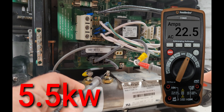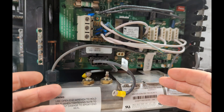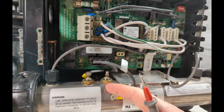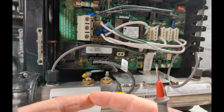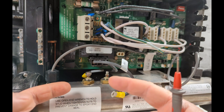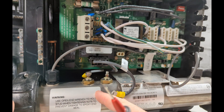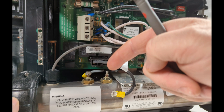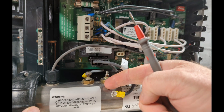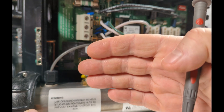The reason I show you four different ways to test — ohms, volts, continuity, and amps — is because each one has limitations. Sometimes you'll get continuity even with a pinhole in the element, or you'll get volts on the element but then zero amps. That's why I show everybody all four tests on a heater element.